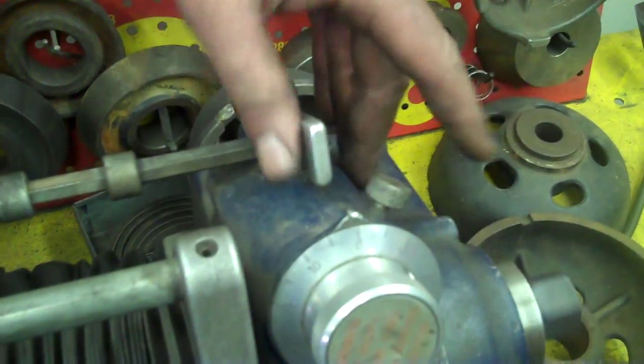The last thing we've got to do is a non-directional finish. I'm going to come on this side. Disengage our feed — this is how you disengage your drum feed, just pull that back. I'm going to go in here and do my non-directional finish from the back side, away from my bit. Don't ever let your hand go near the bit. You're going to go back and forth putting a lot of pressure on it. Turn it off and we should have a nice clean finish. Pretty good finish right there. Unfortunately, this drum is completely gone — there's no chamfer. The chamfer's completely gone on it; it should be about that much thicker. So this drum is completely gone. I'm going to show you in another video how to mic this out.